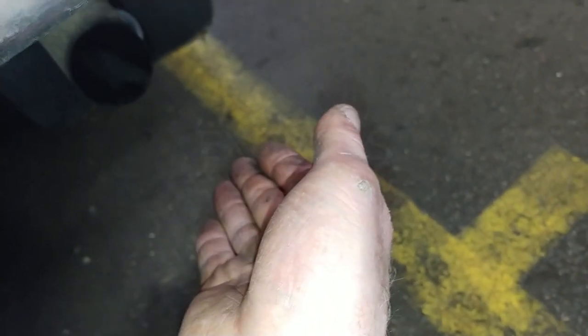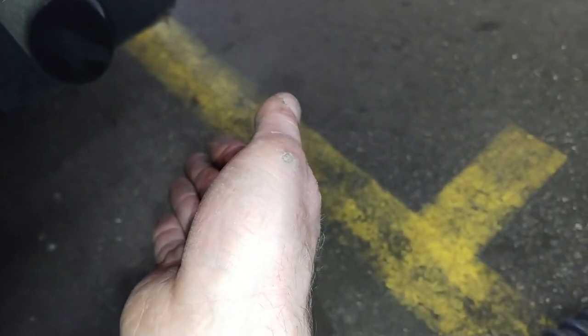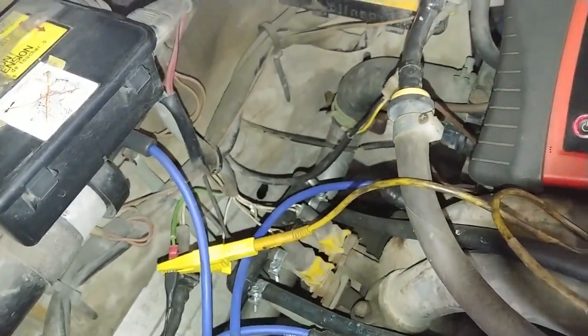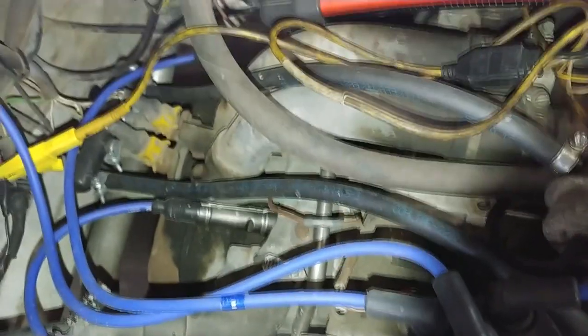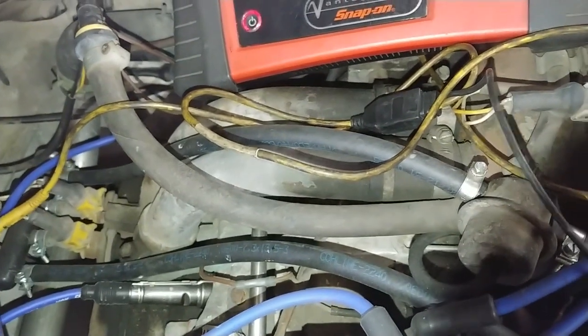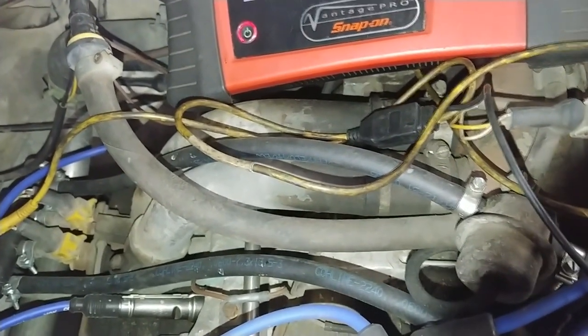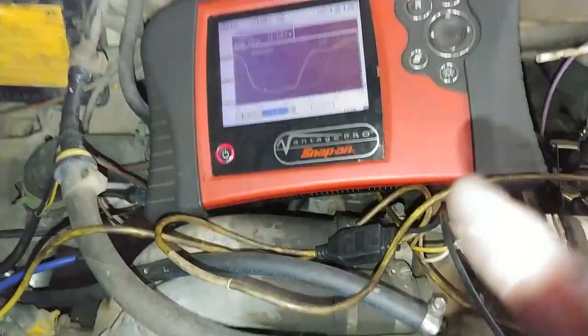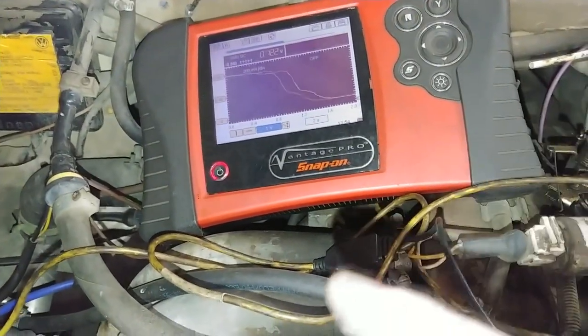The exhaust already smells way better, not rich anymore. So again, this was the main reason for the running rich. It might be a good idea to check distributor caps and spark plugs as well, because they're probably all black, but as you can see it's running, and they'll clean off themselves now that the air fuel mixture is good, or that now the engine computer can control it.